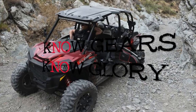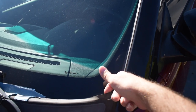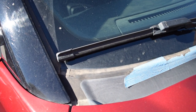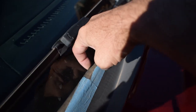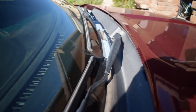Let's step outside and I'll show you exactly what we're talking about. As you can see, a lot of this is starting to wear away — it's cracked and dried. Here's some of the painter's tape I used to hold it down, and it's cracking as well. Here on the passenger side you're getting the same thing. I can almost get the tip of my finger in there. We're going to be pulling this off. To do this you have to remove the windshield wipers, which is supposedly pretty easy, and then there are a couple of clips inside which we'll show you.